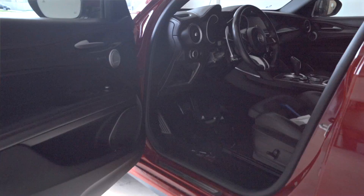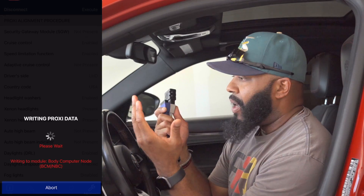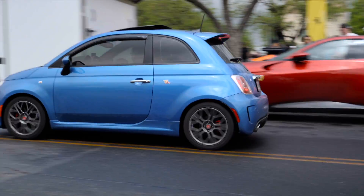I called the dealership, but when I considered paying more than what I paid for the brake parts just for the service, plus the cost of the bypass, cables, and adapter, it made more sense to buy parts and tools I can use multiple times. So I went ahead and installed the bypass. I had to remove a panel and also remove the instrument cluster, which was very tough, but once I figured out what I needed to do it was fairly simple. After navigating through the systems, I got everything recalibrated, took the car for a drive, and was no longer in limp mode.